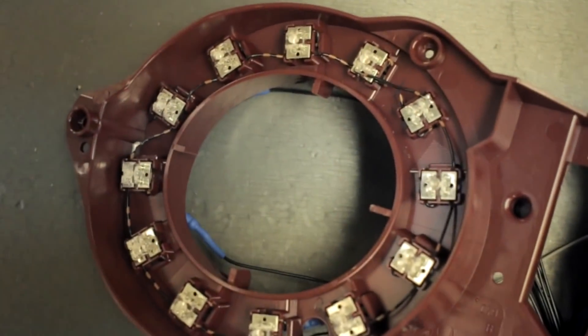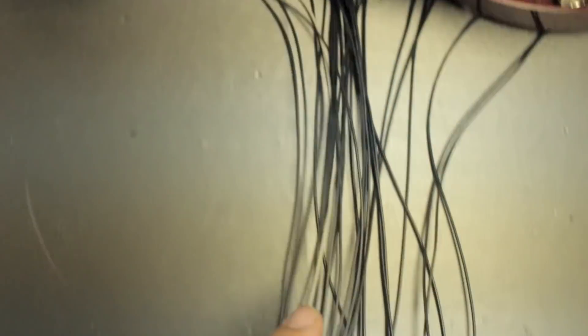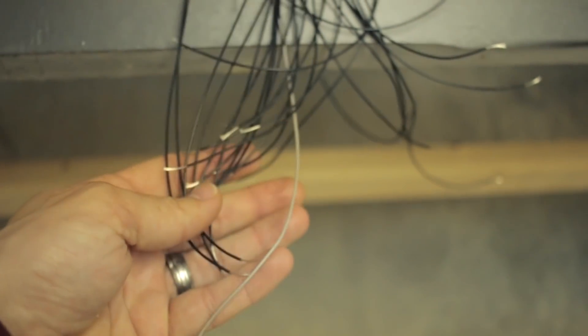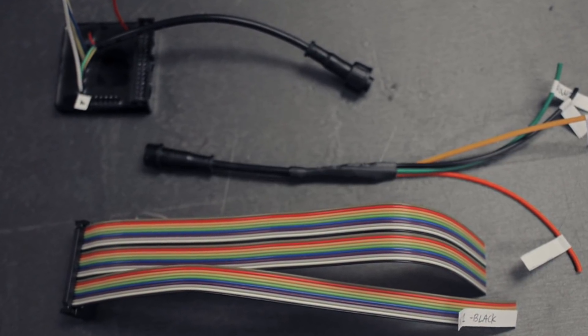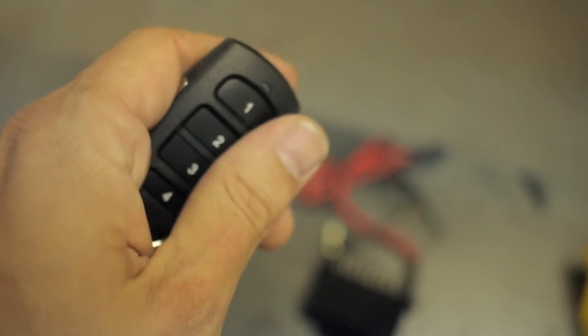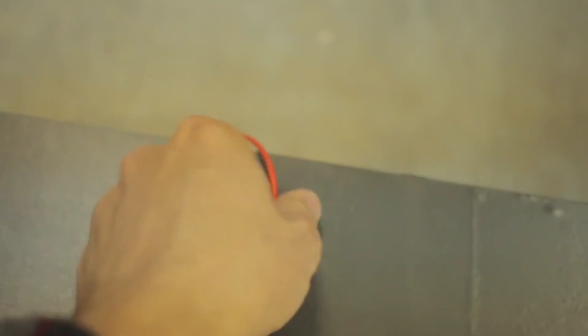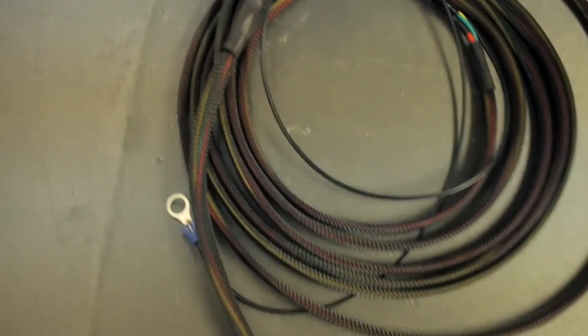All of these have individual wires that power up each LED. What we have to do is have something to connect them to so that we can control them from a wire harness. In this case, you have this dope little remote that is going to turn on different bonus modes. To have this thing work, it's got its little controller here hooked up to something — wiring wise — that runs through the car to tell these tail lights what to do. And that is what this beautiful piece of soldering and sleeving and all that — just fancy jack wires — is for. This is a wire harness that is going to allow us to send the signal to the bonus modes on the sequencer.